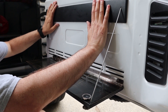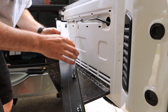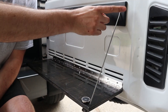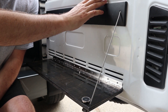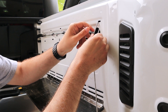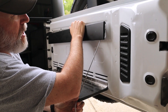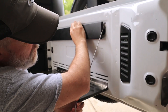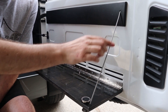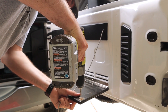So what I did was I pried off this back trim area. The way you do that is you lift from the bottom and you snap it all the way out, and then it latches in at the top with these plastic-type hinges. They have these metal little latches that snap in and they work out great. All I did was tie it into the existing holes that were there. Obviously I don't want to cut into any metal frame — I cut into the plastic trim. But the metal frame I don't want to do that with rust and such. So I tied it in there, melted it all together, and anchored it. Then I figured out where on the trim the cord would be coming down, put the cord where I wanted it on this point of the shelf, marked it on one side and from the top, found where they connected, and drilled them. I drilled it at sort of an angle so that it would come out and not rub, and that seems to have worked out real nicely.